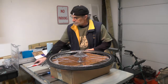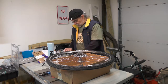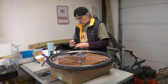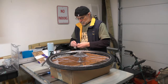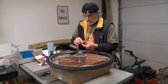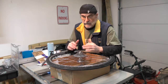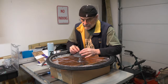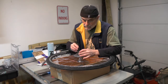I'm going to take a little bit of grease — not just the threads, that's all, not a lot, just a little bit — working into those threads. It's good to have a little bit of grease on there so next time I'm going to take it apart. In all the literature, you've got to make sure you're getting this thing straight on — the threads are connecting. That's not always an easy thing to do when you're dealing with machine threads.